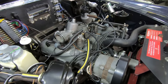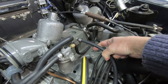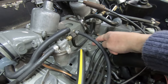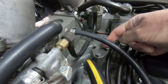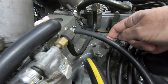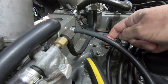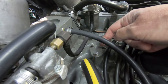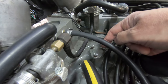Let's have a look at where the Otter switch fits. If you can see this plate here with these three bolts - this is where the Otter switch fits. It's in the inlet manifold, basically in one of the water passages. I was a bit worried in case these bolts were seized, but actually they've started to loosen quite easily. I'm going to finish getting those bolts out and then pull the blanking plate off. There is still some water in the block, but not a lot, because I've got the heater out. We'll get that off and put the Otter switch in and then run the cable inside as well.